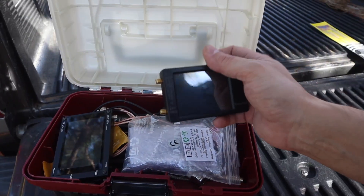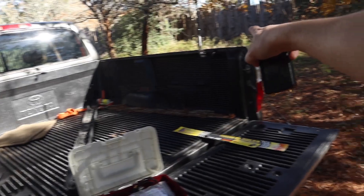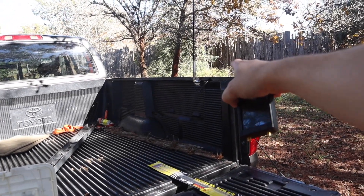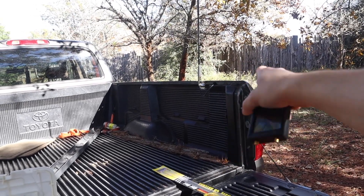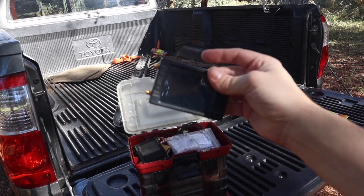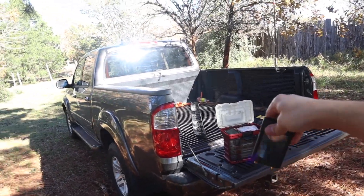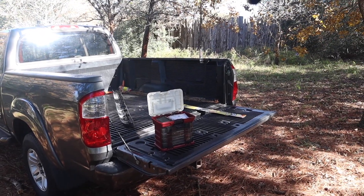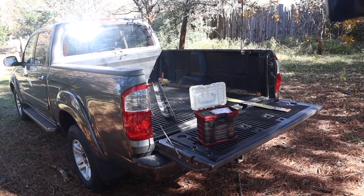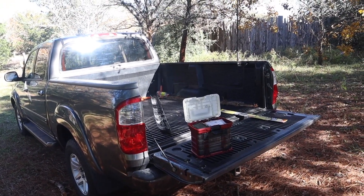I'll put a link down in the description. These are the bee's knees. Once you have it calibrated, you can set it for SWR and we're going to do that. But we have to go to the other end of the coax cable. After bolting this here, it might not be its final resting place, but it's good enough for now. I'm kind of picky about where I put antennas on trucks — how much I'm going to drill into the thing. So that coax runs through a couple of grommets and into the bed of the truck. We're back here at the edge of the property because you don't want to do this in your garage — you'll get all sorts of bouncing off the walls and ceiling. You don't want to do it right up against a metal building either. Just drive out into a field somewhere, a big open parking lot. Maybe not a Walmart parking lot with all the halogen bulbs humming. Just get somewhere nice and quiet and that's going to be your place to tune for your best SWR.